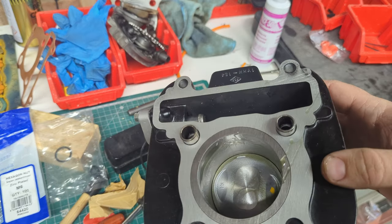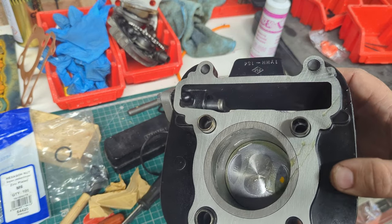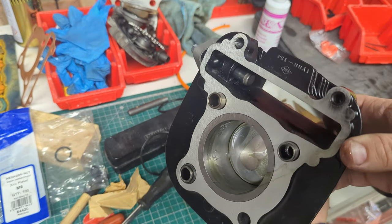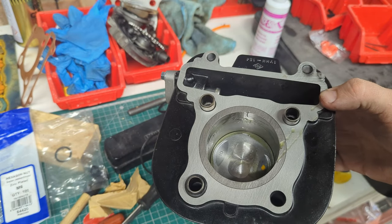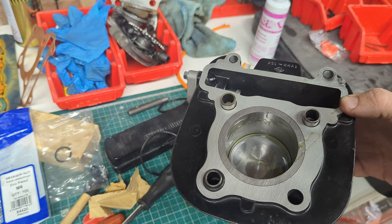The piston is in now and I've pushed it up and down in the bore — you can see a nice pattern where the lube has been left behind. Just give it a good visual inspection to make sure there are no scratches or anything that might indicate a ring is broken, and make sure the piston is aligned. Then we're nearly ready to put this back on the bike.